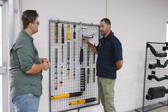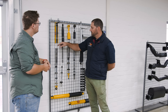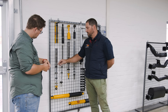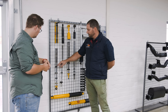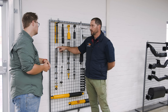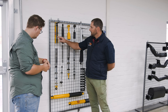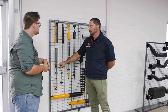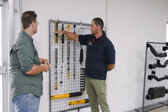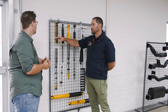The tube you see on the outside - that's basically the tube your piston runs inside. With a normal shock it's a twin tube - you've got a tube running inside of another tube. So basically you've got your compression tube: when the shock goes down, it compresses the oil and it runs through the valving on the shaft here, and it forces the oil through the valve at the bottom. And then when it rebounds, the oil needs to flow back through the valving at the bottom. That's basically how it absorbs the shock. And then this is what you call your expansion tube - the rod pushes into the compression tube and the oil flows to this side, moving up and down due to the volume of the shaft.